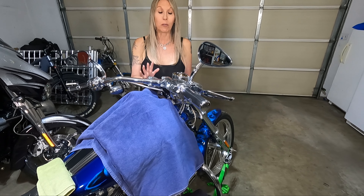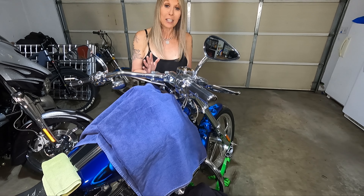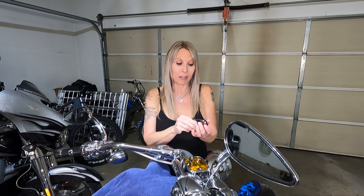I do have the cover completely off. I had to have a little help because once I took out the screws the cover was pretty stuck, and I was afraid to pull on it and make a huge mess with the brake fluid — I know how corrosive it is. I have a heavy towel placed on the tank to help prevent it from eating away the paint. Also, the handlebar moved very easily and wanted to jackknife, so we used ratchet straps to secure the handlebars so they couldn't twist on me when undoing the screws.